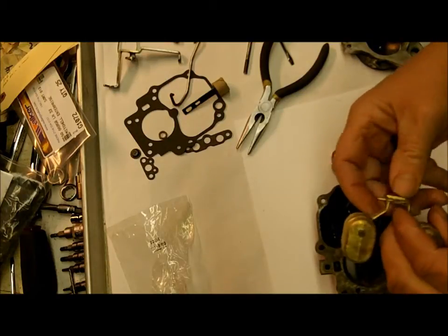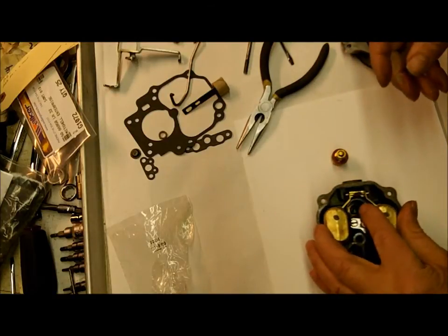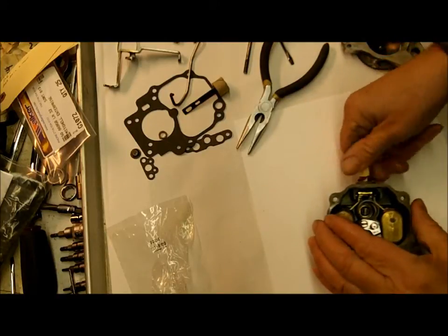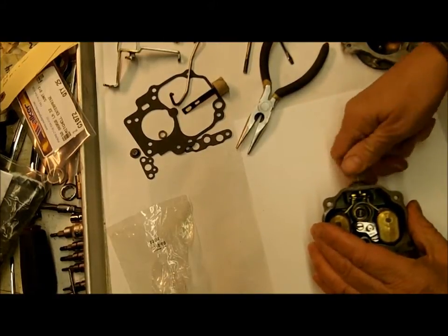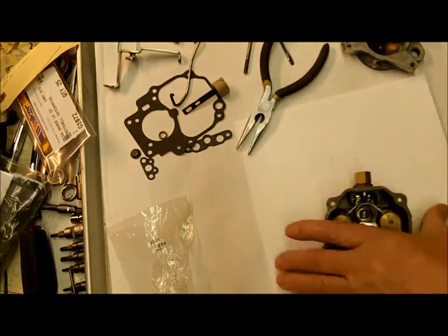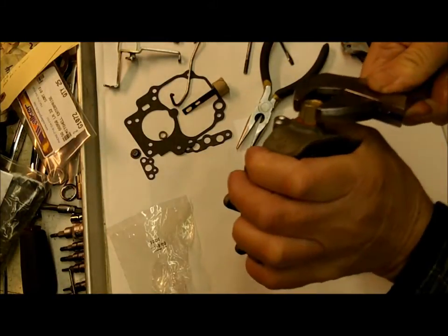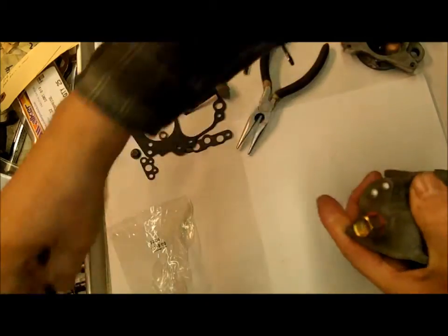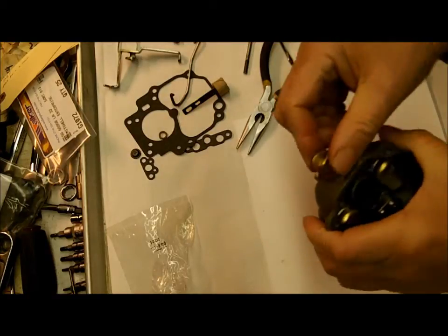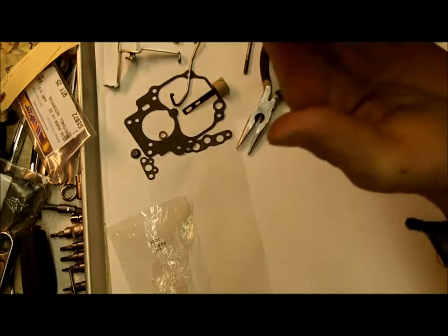No big deal. Okay, so there's your float pin. It's down in there. Simple as that. Put your needle and seat in there. Tighten it down. And you don't have to over tighten these, just snug them up. You got a gasket on there, you don't want to rupture it. If it leaks when you put it back on the car, loosen, then tighten, and that helps seat it. I found that to work pretty good. All right, so there you go, your float,